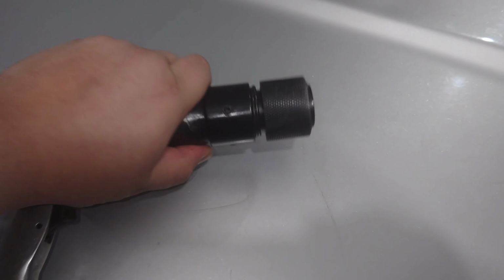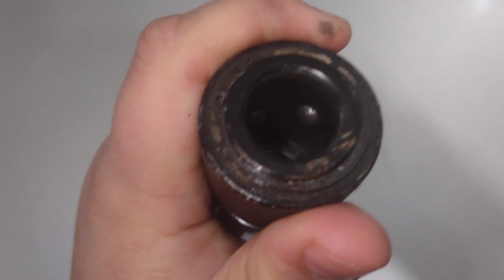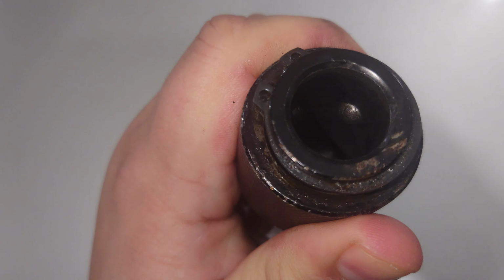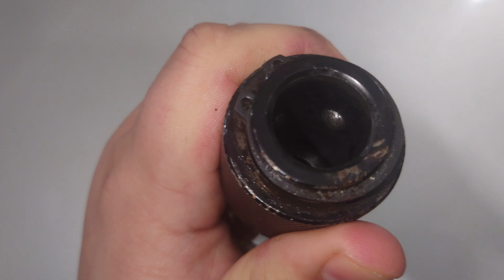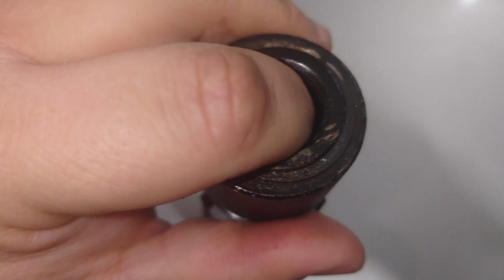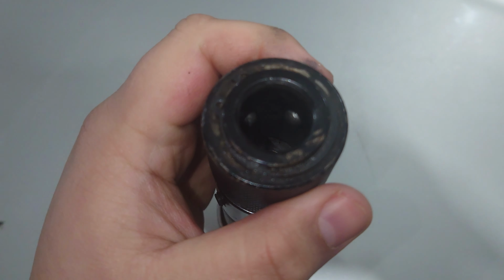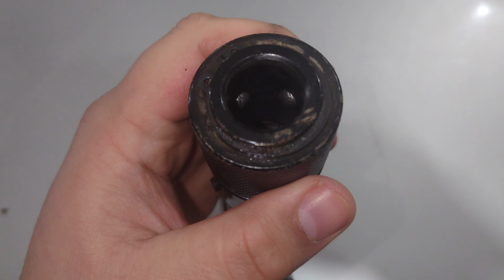Two, the ball bearings that move back and forth when you put the collet down don't always move into the recessed position when you pull this thing back, so getting your chisel in and out is kind of a pain in the butt at times. If you poke the ball bearings with your finger prior to putting the chisel in, that'll work, but maybe spraying a little bit of WD-40 on those ball bearings would help that out a bit.